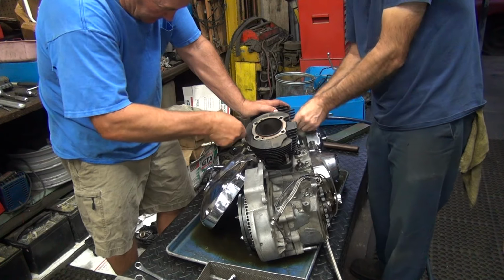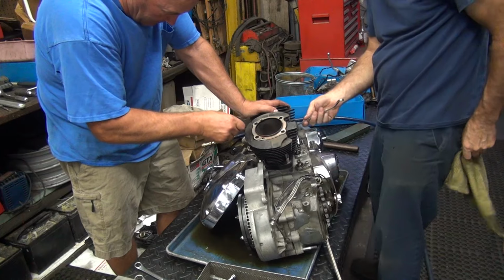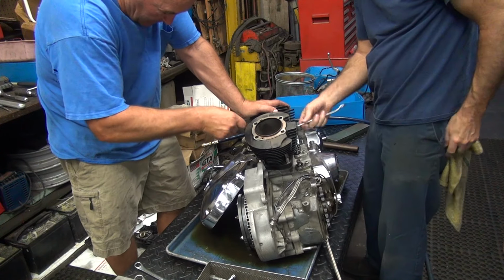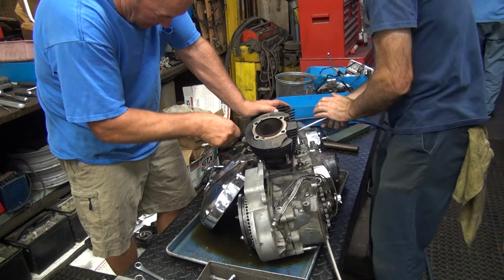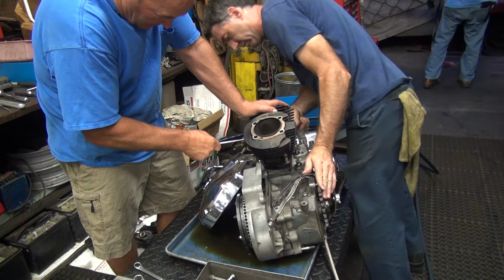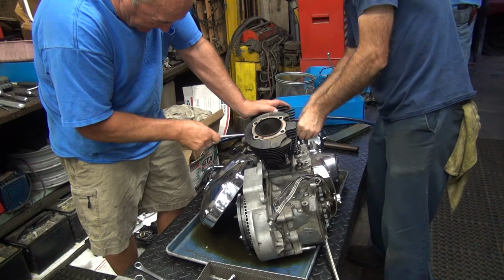Most things, if they've got 55 to 70% of the threads and you torque it up and lubricate everything and go right to the torque, it should never really come loose. Never come out. Yep. Well, I'm just thinking this guy obviously thought he was doing right by Loctiting up. He obviously didn't know what he was doing. He thought. Right. I mean, he was trying.